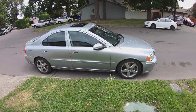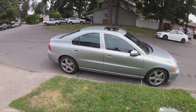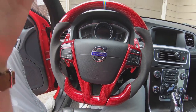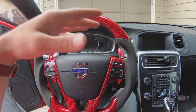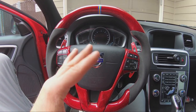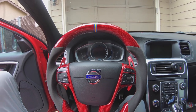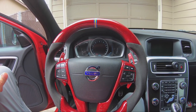For the red car, next week I'm getting all the parts in — installing the brakes and intake manifold one by one. For this car we'll also be ordering parts. Somebody gave me a great tip and I already tried it: when doing acceleration runs or zero-to-60, you should shift at about 4,500 to 5,000 RPM using the paddle shifters. If you let the car rev all the way to the 6,000 RPM redline it actually slows the car down — I verified this.